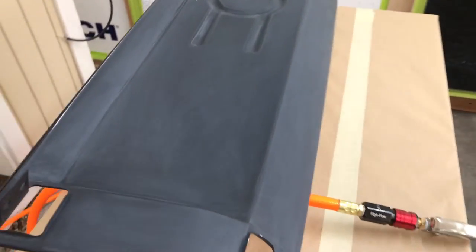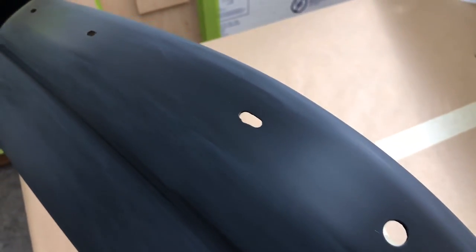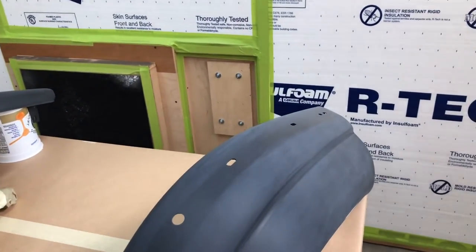In the case of the fruit, you've got a solid mass with a lot of water content, and as it's slowly evaporating out, it wrinkles down. That's exactly what's happening with our solvent-based materials on the paint project. Here are our bumpers - you can see from earlier videos this was scuffed up really nice. It doesn't look like there's any orange peel at all. But actually there are very small micro bits of orange peel. If I scratch it with some 600 grit, you can see even on the smallest scale there is orange peel in there. On this particular coat it's not really going to affect the overall picture too much, but if it's heavy orange peel, it could.